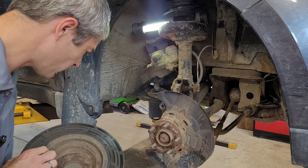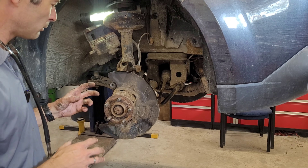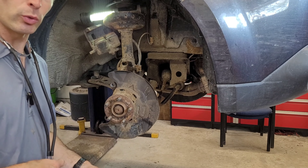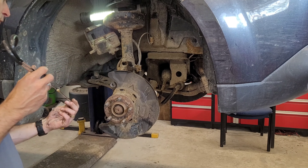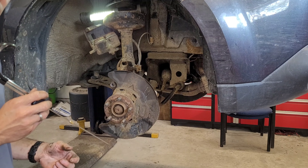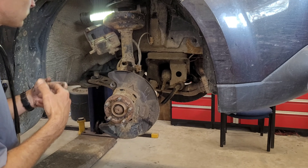You've done your time, little buddy. So we're going to redo this test — I want to eliminate the brakes because they were pretty rusty and maybe that was the noise I was hearing. However, I was listening to it from the back. I'm going to try one more time. Gabby's inside and she's going to fire it up for me in a minute. Then we're going to hope that it isn't a wheel bearing because that would be easier. Let's see what happens — fire it up.